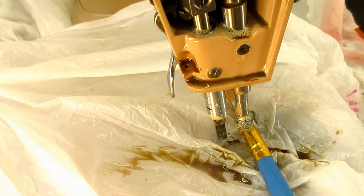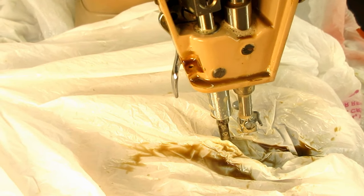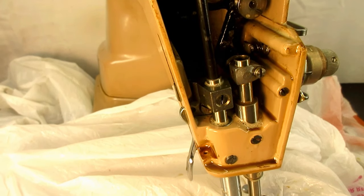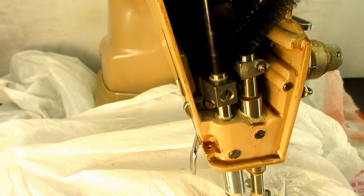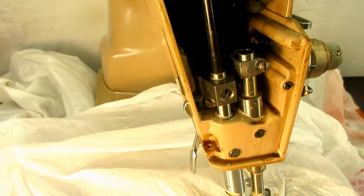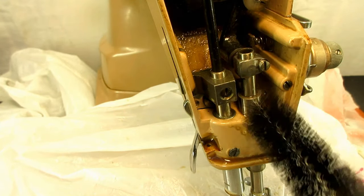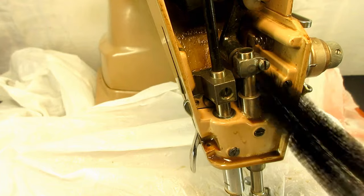So I'm going to lower the presser bar down to expose a little bit more of the end of it, and I see everything is running out of here now, very, very clean, and everything's loosening up real well. This would be another place that, if needed, I could get some of these bottle brushes back into these areas that are hard to get a toothbrush or a wire detail brush in, to get back in and scrub those areas. Okay.